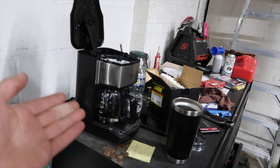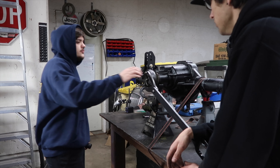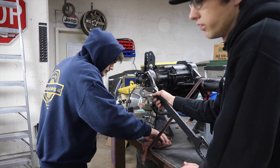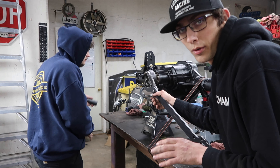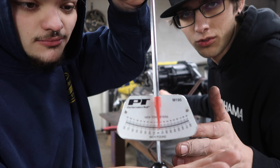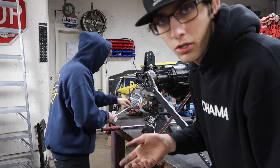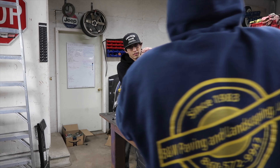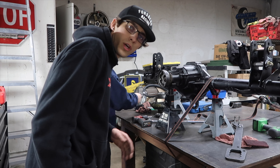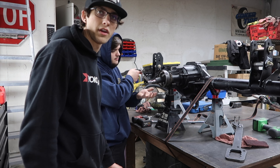Made some shop coffee - we got a coffee maker actually, my old one. So we got to get all this play out that Brandon just wiggled, and then once we get to like no play we're pretty much right on the verge of pressing the crush sleeve - which is a one-time thing, we cannot back it off too much. It's an inch-pound turning torque wrench - you need a manual style with a needle so you can spin it and see how much turning torque you have. It's a certain spec: you don't want too much, you don't want too little.